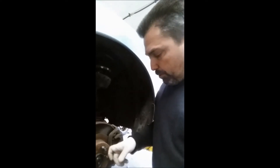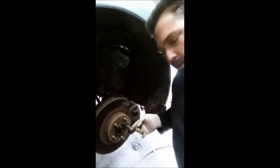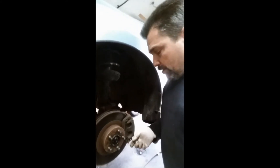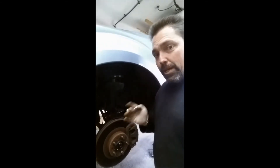If you have any heavy corrosion, clean it off. This one is pretty clean — we did brakes not too long ago. Even up in the northeast with tons of road salt this one looks pretty good. If the wheel was sticking, a little never-seize goes a long way. Put a little oil on and do a quick check — if the nut goes on nice and smooth by hand, you're good. If it's binding or sticking, something is stretched — usually it's the nut, not the stud. Buy a couple of new lug nuts.